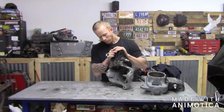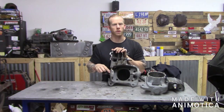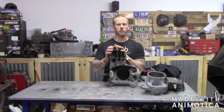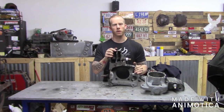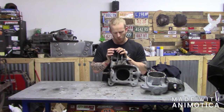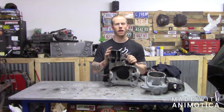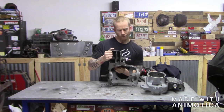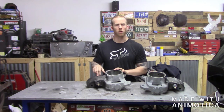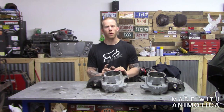One thing to keep in mind: if you're trying to preheat these by putting them in a fire, you need to watch your ball joints because it's going to burn the rubber around them. In my case I didn't care because I'm replacing the ball joints anyway. A torch would be a lot better because you can put the heat exactly where you need it. If you're interested in these high steer arm parts from Artec, make sure you contact Cardinal Off-Road for those. As far as drag link and tie rod, I'll be doing that in a separate video when I get a new pitman arm. I hope you enjoyed the video — if you have any questions make sure you comment, and don't forget to subscribe.